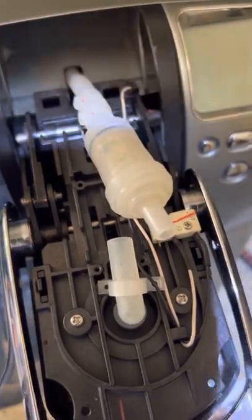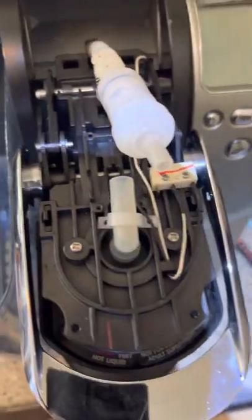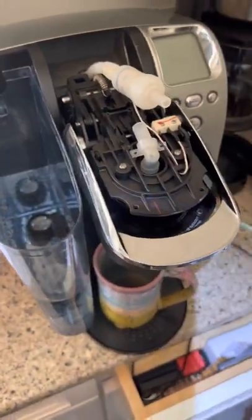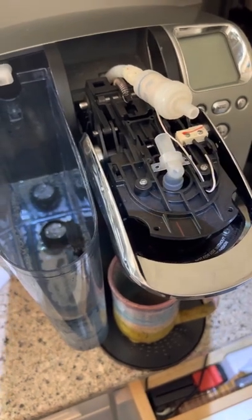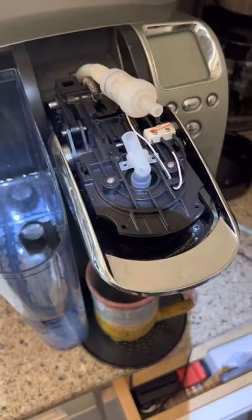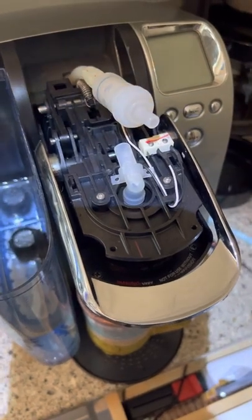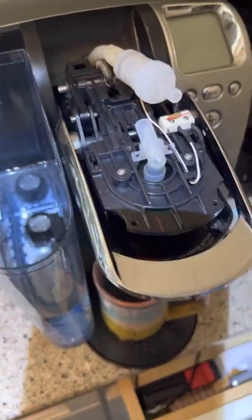What I did is I was careful and I filled up the water container, and sure enough, water started running through it. I went ahead and descaled with some vinegar — I ran quite a bit of vinegar through it, and then I ran a couple containers full of water through it, and it works like a champ. The flow was very restricted, which was obviously just due to scale and crud in the lines, so doing this allows you to flush it all out.